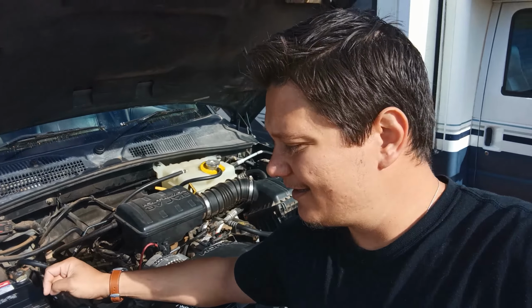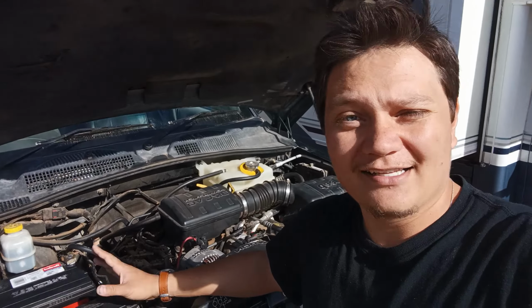So I did some research, and lo and behold, I found out that Jeep has an O2 sensor fuse. So I changed it, and I never knew that Jeeps had that fuse. I don't know if all Jeeps do, but for sure the Liberty does, and I know the Cherokee does. I'm not sure about the Wrangler. I know the Grand Cherokee does, so the WJ, and probably even the ZJ. I changed it, and still no fix whatsoever. I forgot to mention that the fuse I changed was blown. It was done for, toast. It's a 15 amp fuse. I replaced that, still.